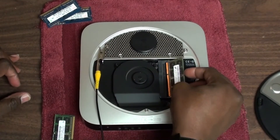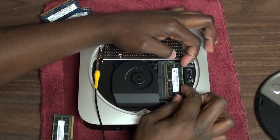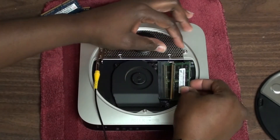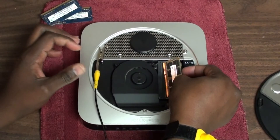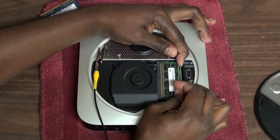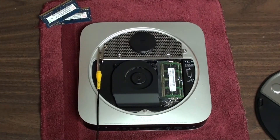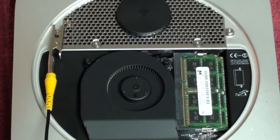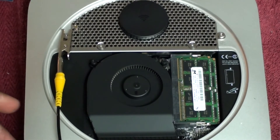There's the old RAM. We're going to take the new one and put it down at the bottom. There you go — that's in. Push it down until you hear the clicks, and there you go. That's how simple it is. I'll zoom in a little bit closer — there you go, the RAM is seated in there perfectly. If I was making this video on the other one it would take a little bit longer, but that's how easy it is.